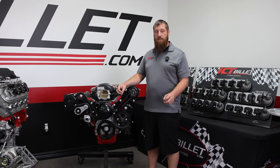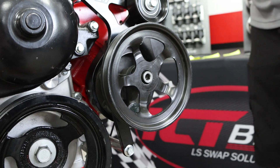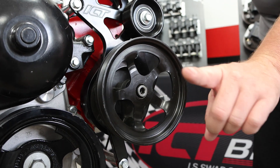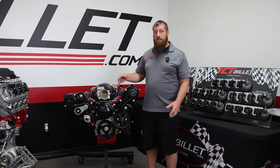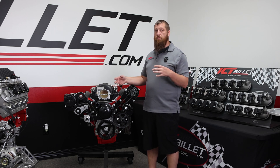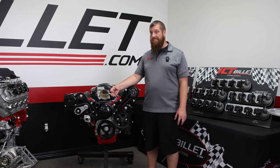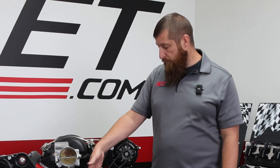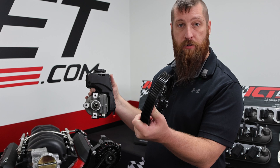The fifth thing is your power steering pulleys. You can over-press them or not press them on all the way. Make sure the shaft of your power steering pump matches up with the front face of the hub on the pulley. Also, you can't swap power steering pump pulleys between applications — a Camaro pulley on a truck pump has the same shaft diameter, but the offset of the ribs versus the hub is different and will create belt misalignment. For example, a fifth-gen Camaro pump and a truck pulley have a different shaft size and obviously that's not going to work.